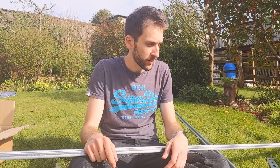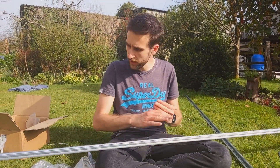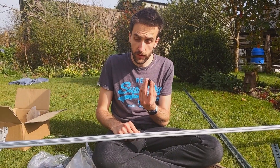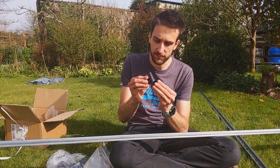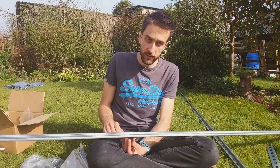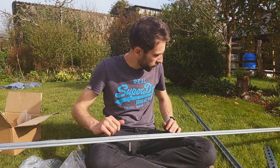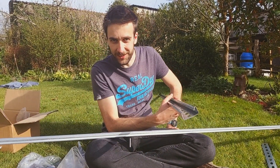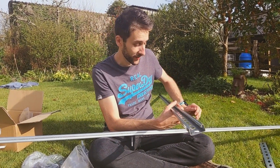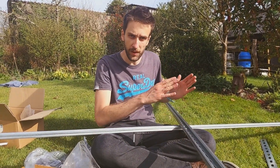All of this kit together should cost us well under 100 pounds, probably not much more than 50. We're going to have one of these going on each side of the van as the lengthways pieces. We need to raise them off the metal roof, so we've got these rubber spacers — just hard rubber — which can be bolted down in four places on the roof, and those are the ones going across that way.